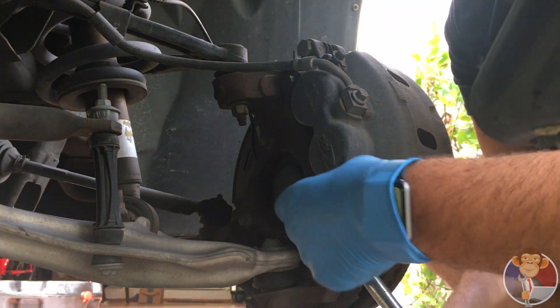You're going to need one of the old brake pads. Place it right there, then sandwich those two together like that and start twisting. You're just going to keep twisting and, little by little, you'll see the piston starts to collapse inward right in here. Once you get this brake pad almost completely flush, you're going to take the C-clamp off. You can see that the piston back here is almost flush — this gives the caliper enough room to fit those new, thicker brake pads in.